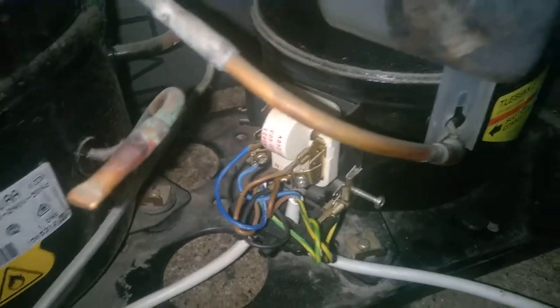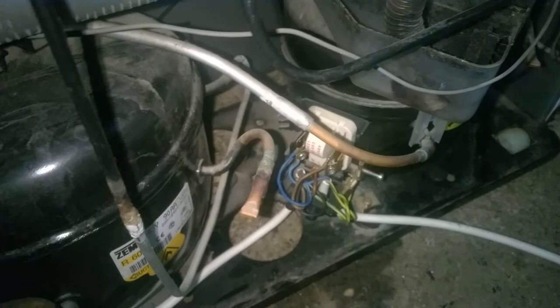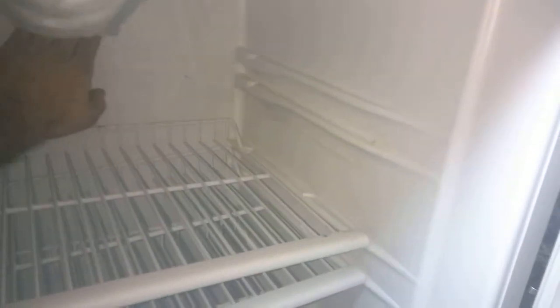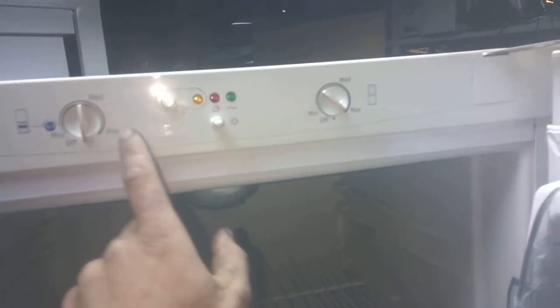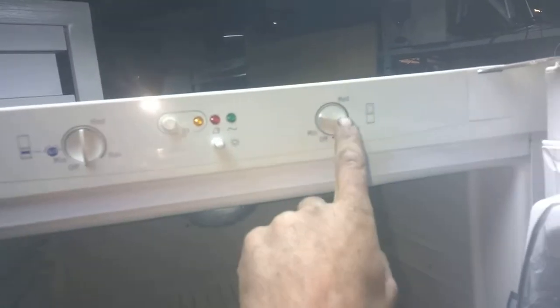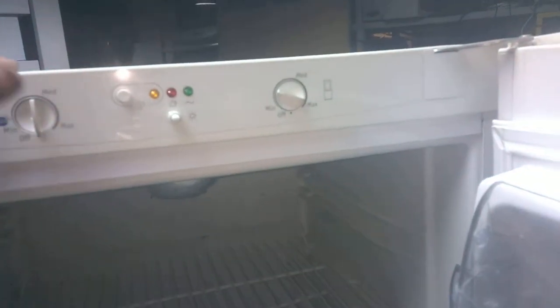I'm going to leave it like this for about 10 to 20 minutes and see if we have some ice on the top compartment. There should be a small layer of ice on the back wall of the fridge, indicating that the compressor is good and there is still refrigerant in the tubes. Five minutes have passed and a thin layer of ice is already starting to form on the back wall — so this thing is fine. We are going to remove this plastic bezel and see where the problem is. From the feel of the buttons, I think this is a mechanical thermostat, so it will probably be a fault in the thermostat. If it's an electronic control module, we'd have to investigate further, but I'm confident we will fix this one also.